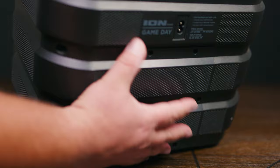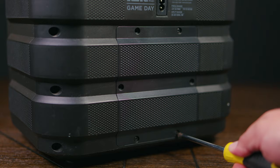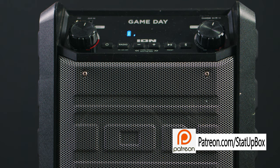We gently shove the battery in its spot. Now we're ready to place the cover back and screw our screws. Remember, if you have a faulty battery that's not charging, you can always use the speaker connected to the outlet — the only thing is it's not going to be portable unless you have a long extension cord, or it's no longer going to have the rechargeable part of the system. Once you feel the screws are tight, that's good enough. Connect your system and place it to charge for a few hours, and now you have a brand new speaker again that looks old on the outside.